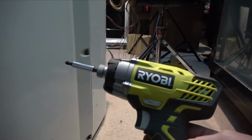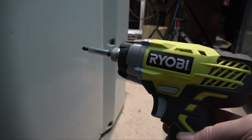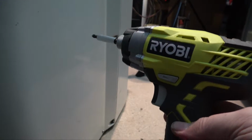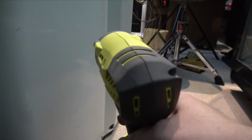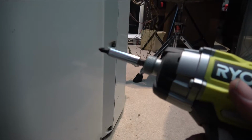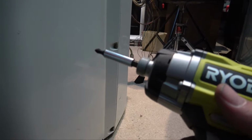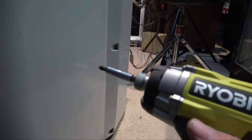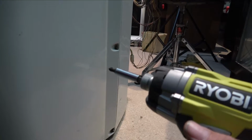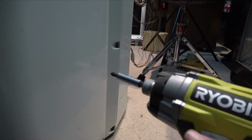So if you don't have a JIS screwdriver, then you need to use an impact screwdriver to get these guys out, which I have here, a cordless one. And I tell you what, they're in so tight that it barely gets them undone. The first couple of attempts to turn, the head just stays on the screw and doesn't budge. At least it doesn't spin though and burr the screw head. But after a couple of impacts, it slowly releases the screw.